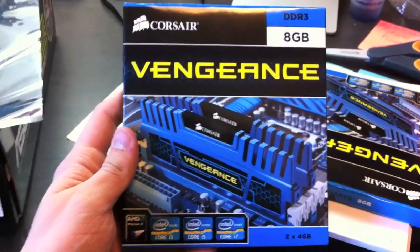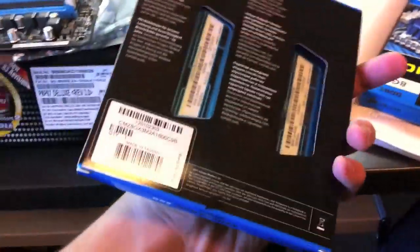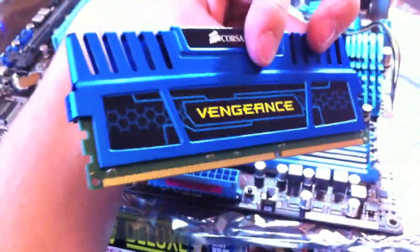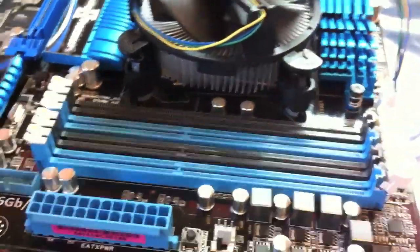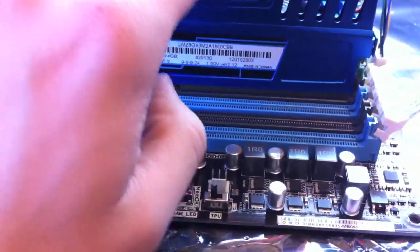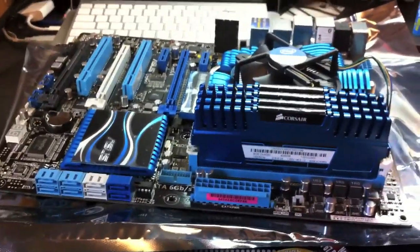I flipped to the next page of the manual and realized I have to install the RAM next. The RAM I'm installing is 4GB chips of Corsair Vengeance memory with these nice heat sinks. I picked this up from Tiger Direct for about $90 for both of them total. For all of you curious on how to install RAM, there's a little notch in the bottom and there's only one way to install it. The only thing you have to make sure is that you've unlocked the channels, and once you've done that it's just as simple as lining it up and pushing down until it locks in. And there we have it — all four sticks of DDR3 RAM locked and loaded.